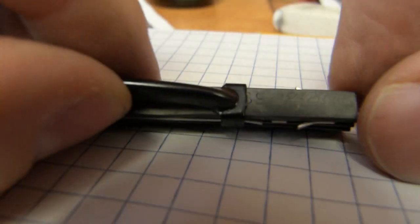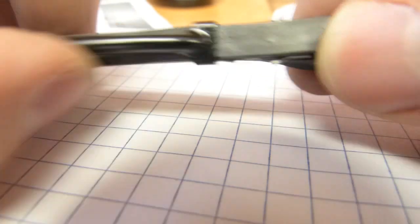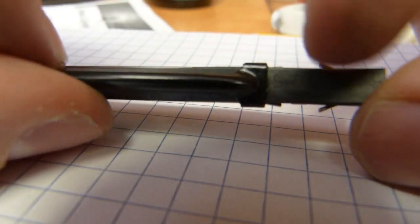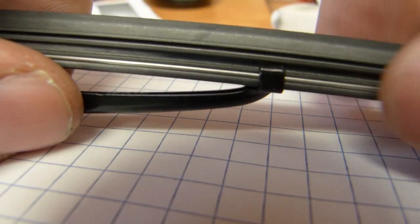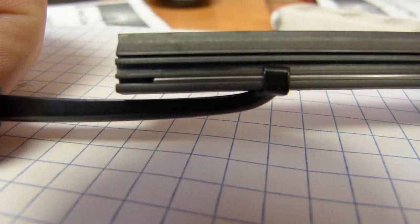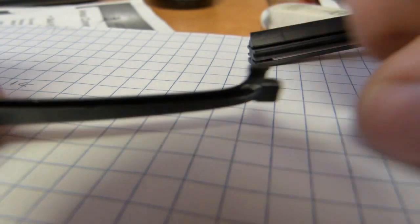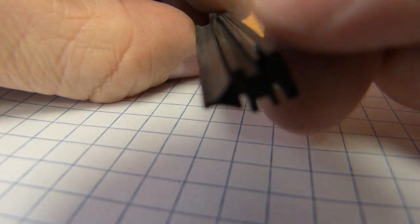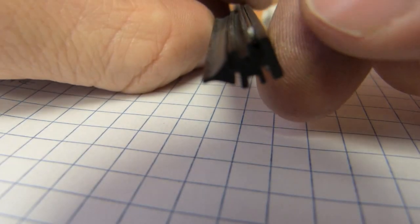I've bent the lower halves of the claws — this one and this one — just with a pair of pliers. Very simple. Don't touch the others. You can just pull out this whole rubber strip with those metal edges from this assembly, because these claws just let this rubber strip with its metal edges slide in this channel or groove. Very straightforward.